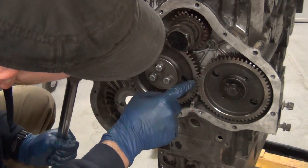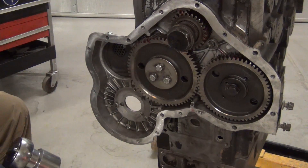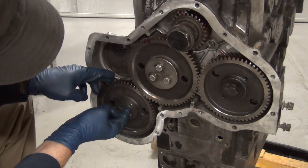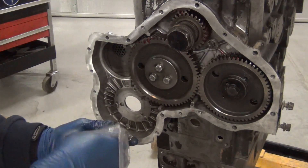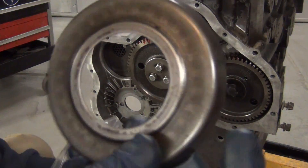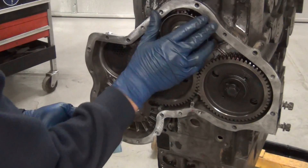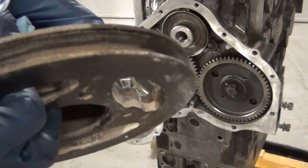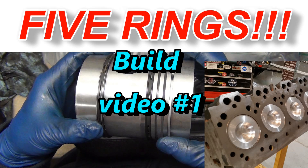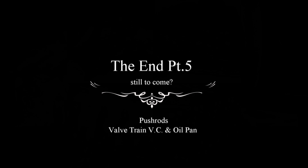These are sloppy marks — I should have chosen different teeth. I like precise timing marks that make sense. OCD just goes nuts on those — I want it to be perfect, right in the middle. I've got a bag of timing cover bolts, and in that bag there's this piece that is meant to be on there against the gear — you can read the witness marks on this side, which goes toward the gear. We don't really need to crank this over from here on out; everything's moved up and good to go. This is a sealing surface so we're going to have to clean that up — you can see where it's really been gouged in by the seal. I did a three-part series on how to tear the engine down; be sure to check that out.